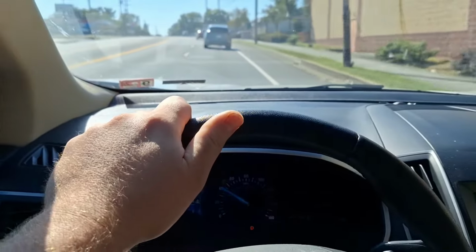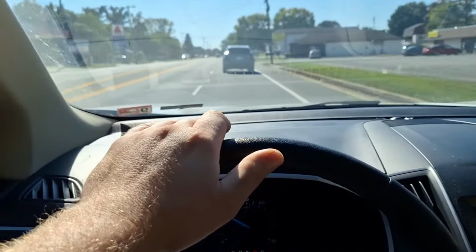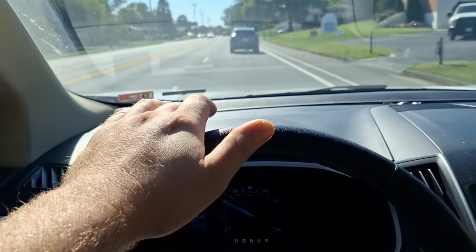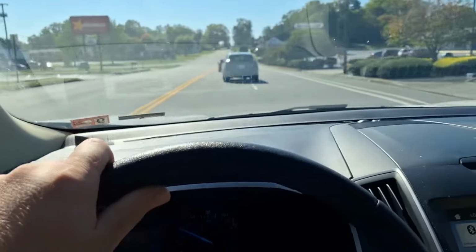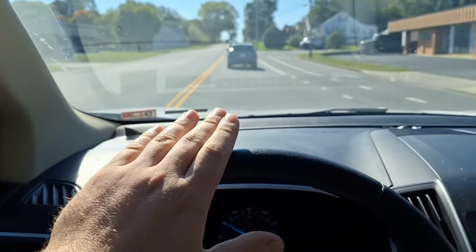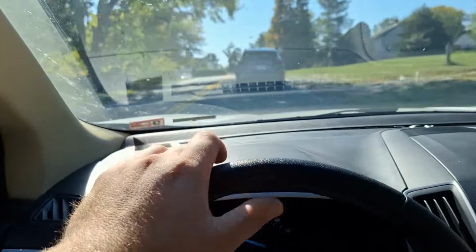When I drove this the first time, all I felt was torque converter shudder. The advisor said there were some firm shifts, but I thought it was just gummed up solenoids. It feels like there's a lot more going on here than just that. Since there's no codes, there's most likely something coming apart in the transmission. So once a gear's fully engaged and you feel it losing engagement while it's engaged, most of the time, if not all the time,